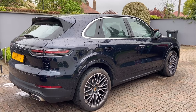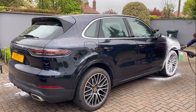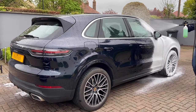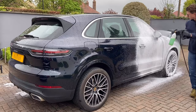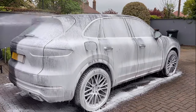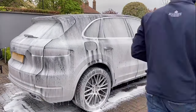In this video I'm going to talk you through how to wash and maintain a ceramic coated car. Firstly, I start by spraying the entire car in a detergent-rich blanket of foam. The idea of the foam is to dissolve and suspend the road grime into the foam, consequently making it easy to rinse off. This step is crucial before any contact washing is undertaken as it helps remove the majority of the dirt.